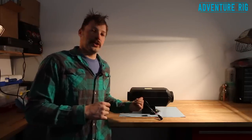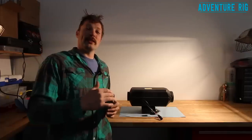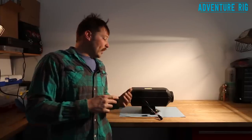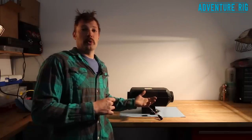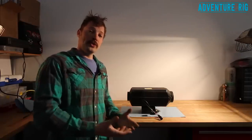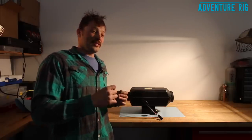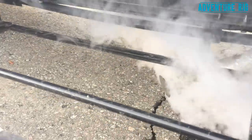The heater has a new function versus our old heater — before they only went to about 60 degrees and always ran. With the new function, you can set them to zero or one degree Celsius, and what will happen is the fan will continue to run and blow air out but the heater stops putting fuel in and the flame burns out. You can also turn them down a lot lower. What they don't tell you is if you're using that function and running it really low, the heater can build up with soot and eventually the thing won't even light anymore. Out of the exhaust it's just billowing smoke — you can't even imagine how much smoke is coming out. So that's the problem I ran into.